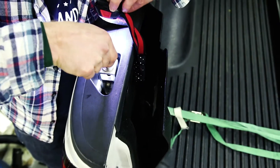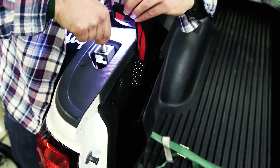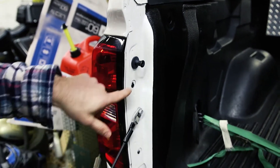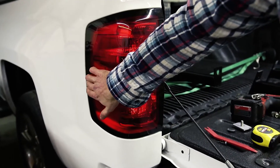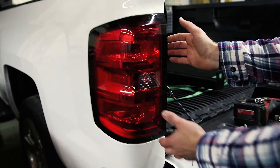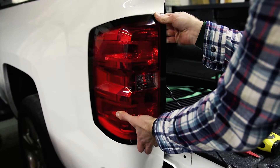You can see it causes the mount to sit flush with the top of the bed rail, and you won't have any of the torquing issues as you tighten it down. To access that hole, go ahead and remove your rear tail light. This is secured by two T15 Torx bits. There are also two rubber grommets that hold it in place, so you're just going to want to grab the edge and pull those out — they are kind of tight, so give it a little force.